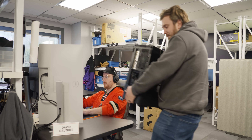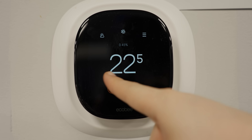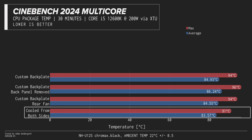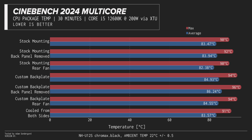We needed a more realistic airflow scenario, so we found a spot in our office roughly equidistant from a bunch of ventilation. We set room temp to a tight 22-ish degrees and tried again. With the custom back plate and a fan, we see CPU temps drop one to two degrees. And with our cooler mounted to the back, we see a further improvement of one degree or less. It's not nothing, but it is almost nothing. When we compare CPU temps with the front-mounted cooler on its stock mounting hardware instead of our custom back plate, it performs better than our back-mounted cooler setup. So all the haters who said this won't work: it does work. It just works poorly.